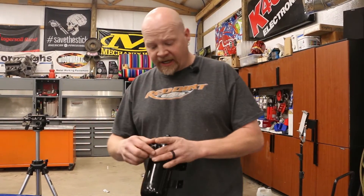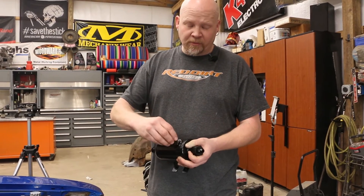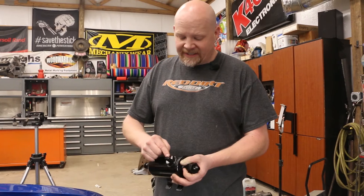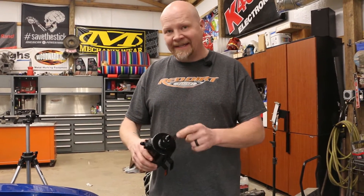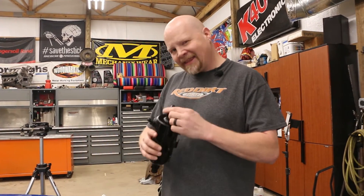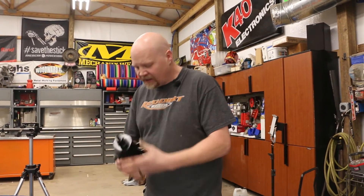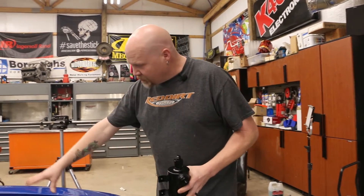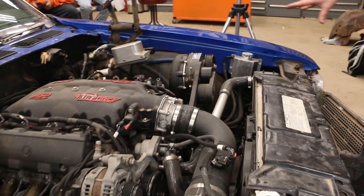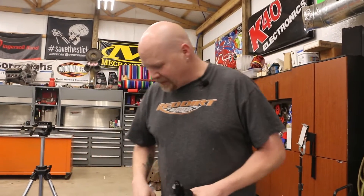This is our Earl's catch can. It comes with some really large ports, but we don't need it to be that big. So I have this dash six adapter from Earl's, and on this one at dash eight — I would have used the same size but I can't get this fitting in a dash six. You can see with our supercharger and all this stuff, we're pretty cluttered under the hood and I want to clean that up.